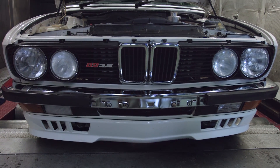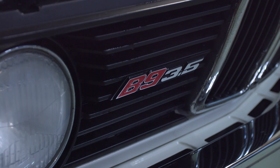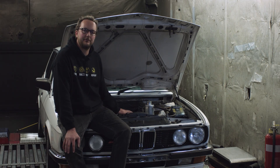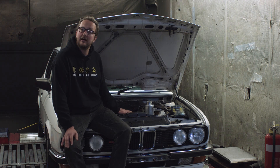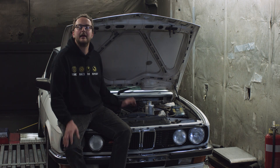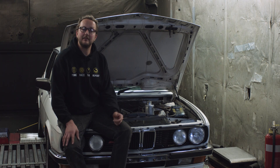One of the things that's great about this setup is that we still want the engine to be drivable. They've actually added an idle control motor to the individual throttle setup so that the thing still starts beautifully. In the morning when it's cold it idles up and it drives the way you would expect a new car to drive.